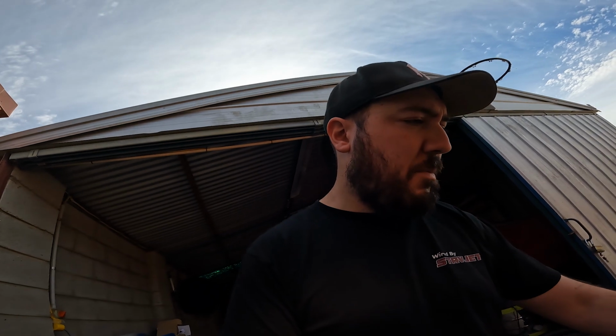I ended up going back with the original carb that I had on here. So this is a Weber 38 DGAS. The originals were a Weber 32/36 or something like that. But yeah, I originally bought a bigger carby for this because I did plan on doing a cool Pinto build. But obviously that fell through at that time. So it's definitely got a lot more fuel than what it needs, as it's just really got a cam in this thing, and the head's been shaved. All right, so two sets of spark plugs later, we got a killer tune.